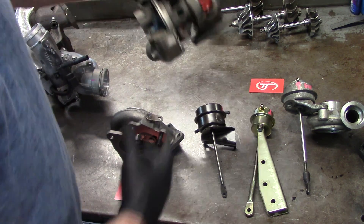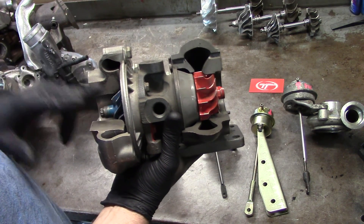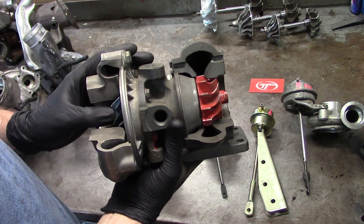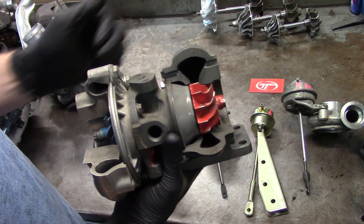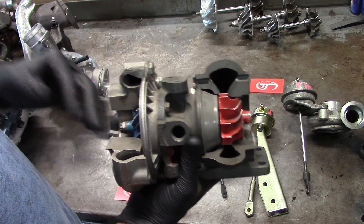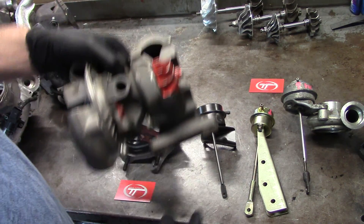The critical part of wastegate control is that when you're under boost, your rotor speed comes up. If you have 10 pounds of boost on the compressor side, the typical gasoline engine targets about 1.5 to 1 — so if this side is 1 at 10 pounds, then the turbine side is going to be about 15 pounds. Once you get above that ratio, you start loading up the turbine pressure, your efficiency kind of falls off the map, and all you're doing is building up heat on the compressor side and coming closer to a compressor surge. I'll go into more detail on drive pressures and ratios in the next video, but that's just a short description.